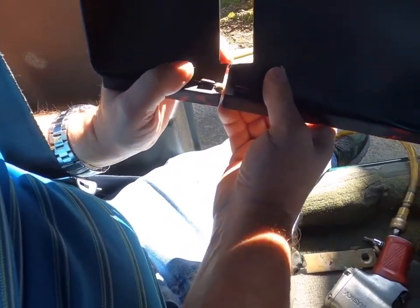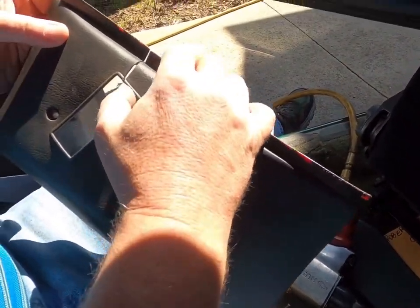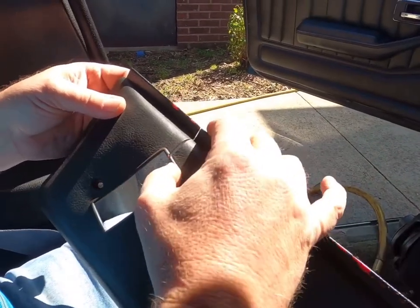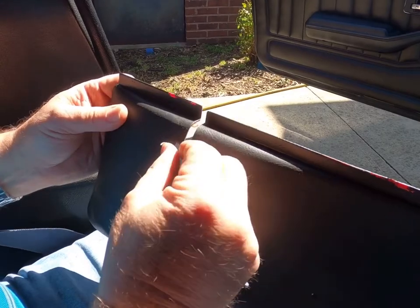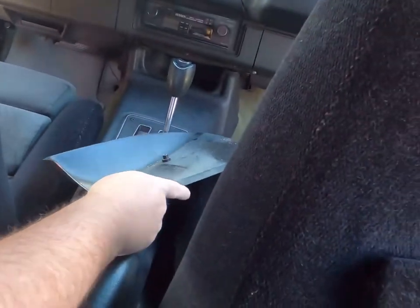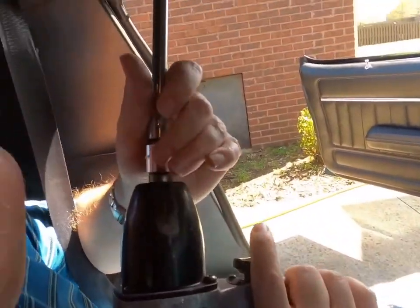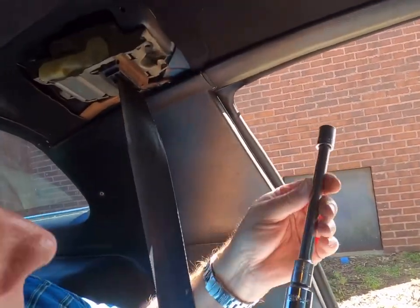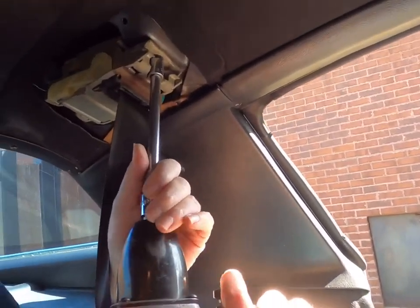This is kind of jagged right there — that was like that from the factory. That's really extra cheesy. That's designed to cut your new seat belts when you put them in. You probably have to do something about that — no big deal, we'll set this out of the way. Since that other bolt wasn't rusted, I'm thinking because they were seat belts they must have put these on really tight at the factory. So I'm just going to come in here with the air tool and back these out.